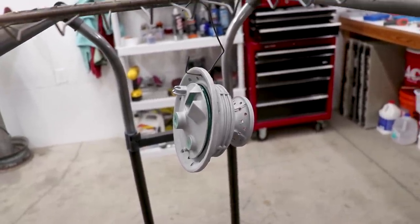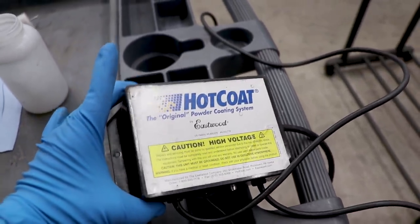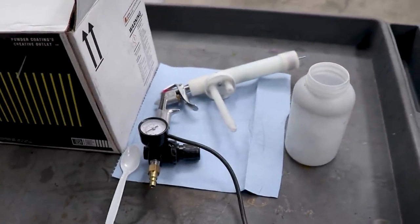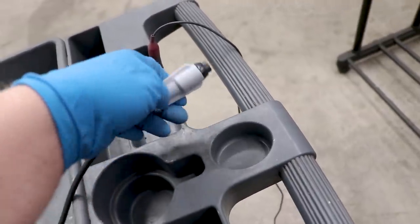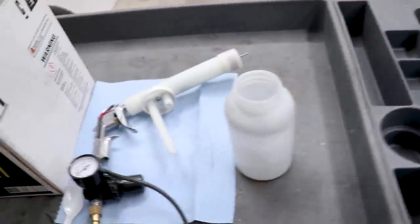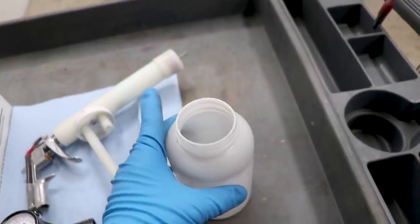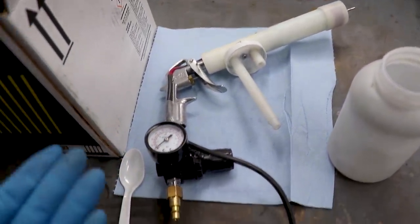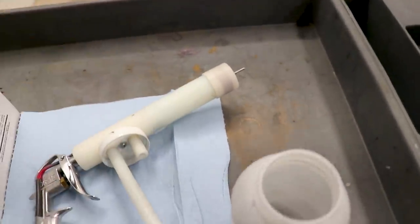The part's all done with the preheat process. And while it's cooling off, I'm going to set up my powder coating gun here. The gun I'm using is an Eastwood Hotcoat - it's the original one, not the dual voltage. Still works really good, it's a nice simple gun. So basic concept is we've got power from an extension cord leading up to the box, and then we've got the ground - this grounds to the part. The button activates the charge on the part, which allows the powder to stick. You want a regulator on your gun. The powder goes in this cup, the cup screws onto the gun, and you have air pressure coming from an air compressor. And then once you get it all hooked up, just hit the trigger - got powder coming out the end. Pretty simple deal here, nothing too complicated.